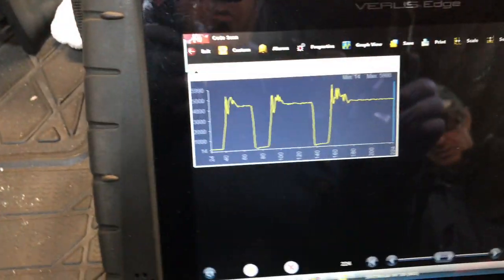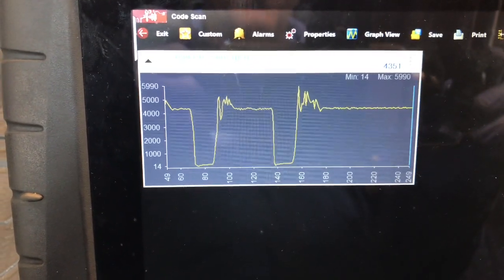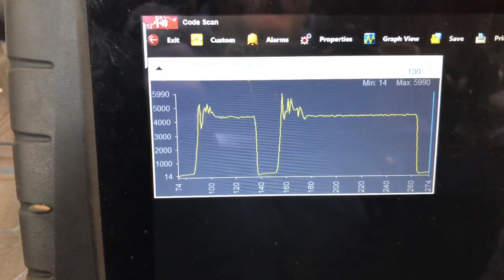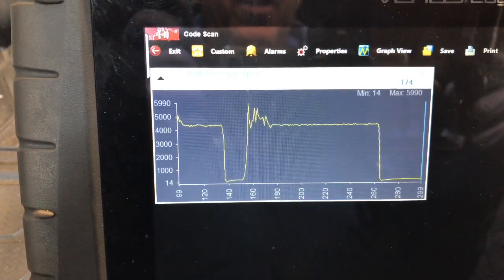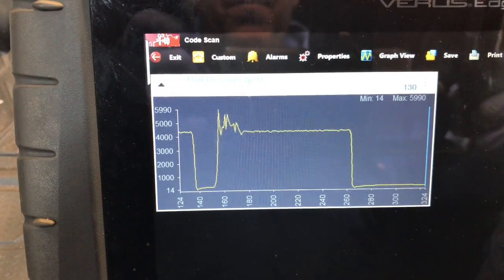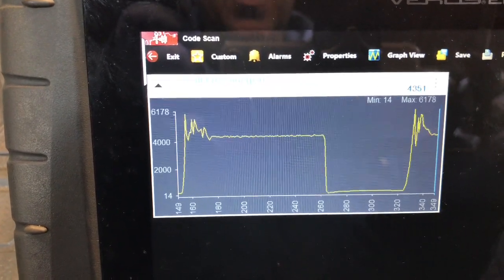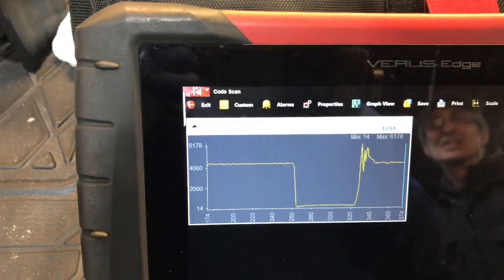So what we've done, we've limited the PID just down to one for rail pressure PSI, so Roddy will crank it again. If you limit the PIDs, it speeds up the data refresh, but I think the next thing we'll be doing is going back into the fuel pressure sensor and back probing it with the scope. Right, my man. I don't think the data's fast enough to give us a conclusive answer.